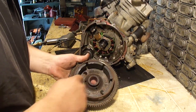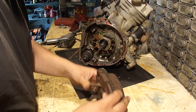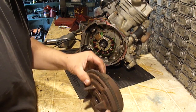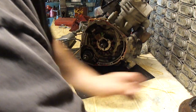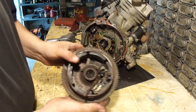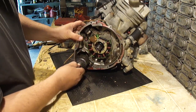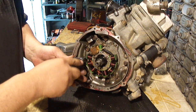Have a good look at these magnets — make sure none of them are broken, missing, or loose. Check your ring gear teeth. It's all fine. I'm gonna take all the parts that I took off of this side and stick them in here on these magnets so they don't get lost. Go ahead and pull the starter Bendix out, then pull the timing plate off with the stator on there.